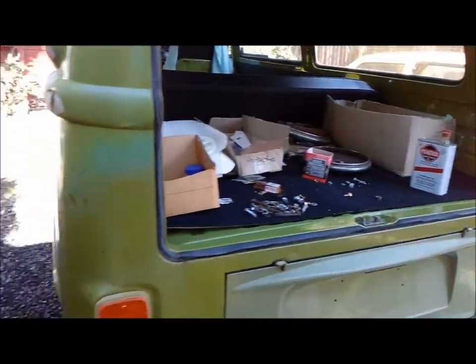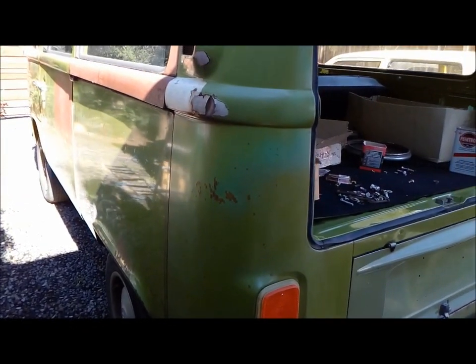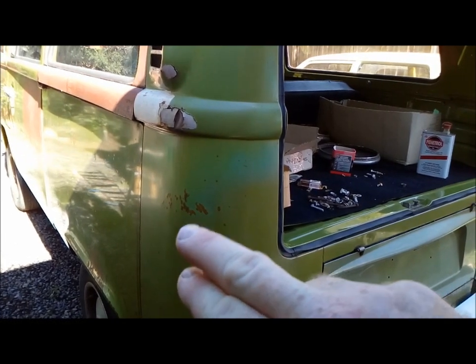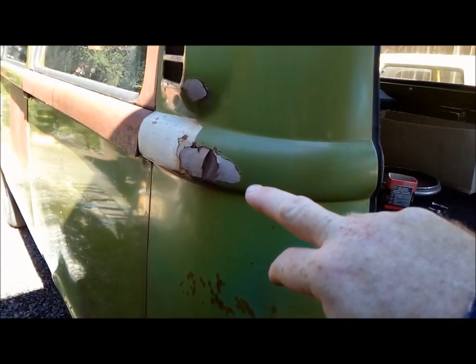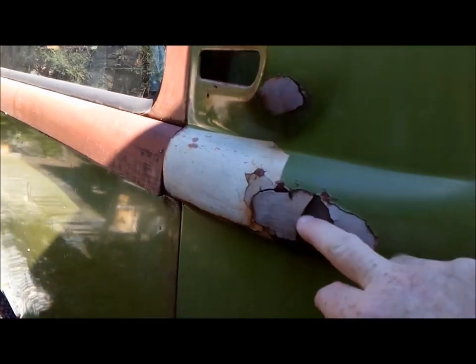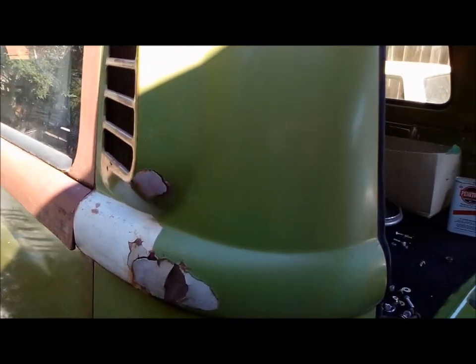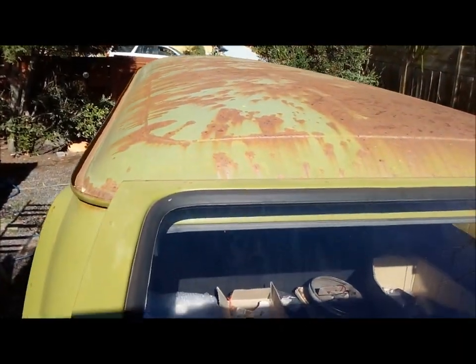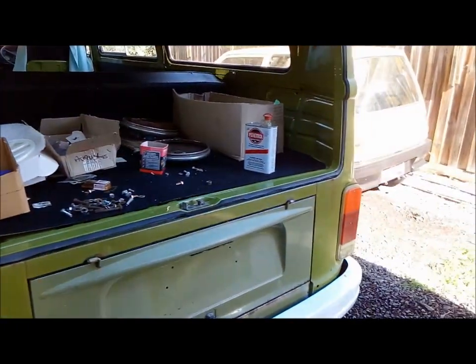So when we have an old car like a KOMBI, and we're trying to preserve the patina on it, it's perfect, because it'll adhere to this where the paint is thin and you've got the surface rust there. It also adheres to some of the cosmetic side of things. But what it's doing is it's also preserving the bare steel from corroding any further. And I don't know if you can see properly up there, the roof cops an absolute beating from the sun.